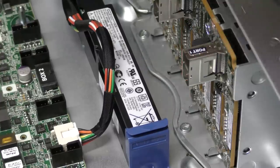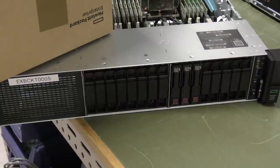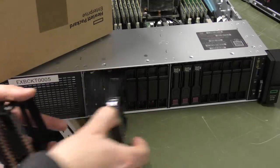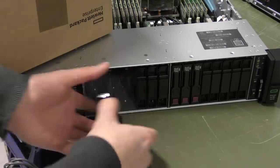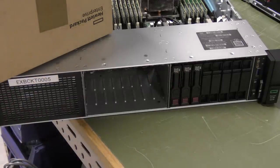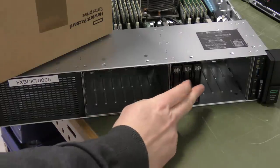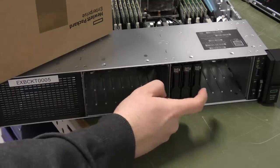To get moving, I'll remove all of these drive placeholders and put in the solid state drives — I want to save those carriers. There are going to be 13 solid state drives in here and they are all 1.92 terabyte solid state drives. These three drives are the operating system — a mirror of two drives plus a hot spare, to keep things safe.